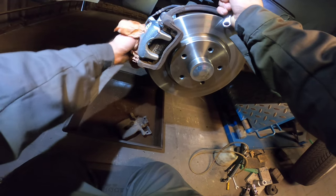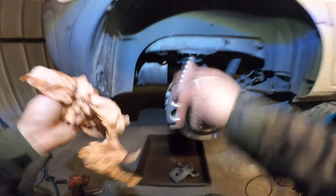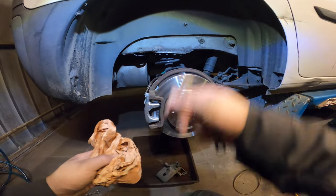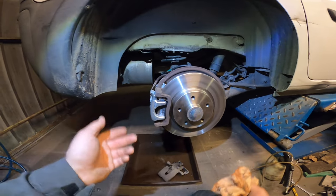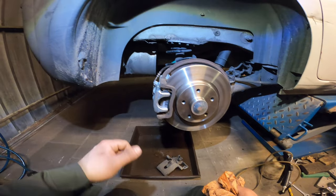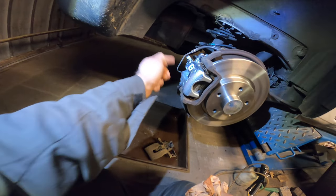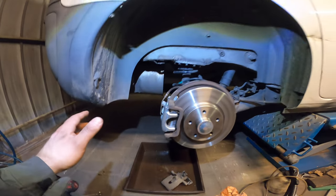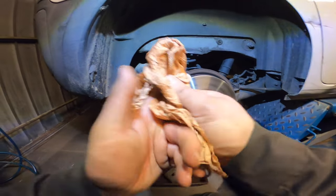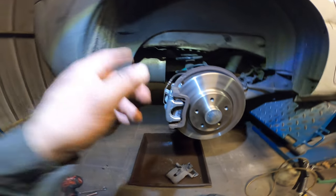Not too hard of course. Don't descend mountain roads with new brakes and don't burn them. But have some emergency stops — a couple of them. Two, three emergency stops, really really good, with good pressure on the brake. And if you don't see any leakage here it's good. If you see a small little amount you have to tighten it a bit more. Go for a spin, check it out again, and then you're good to go. But this one is nicely tight.